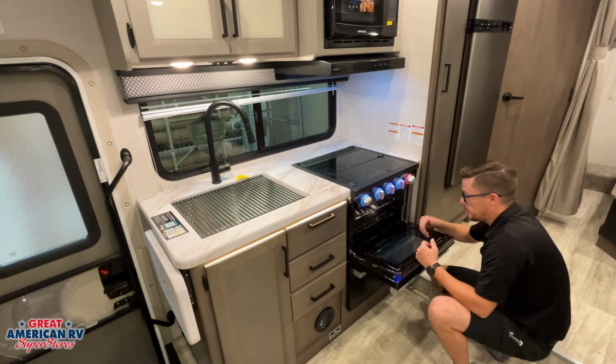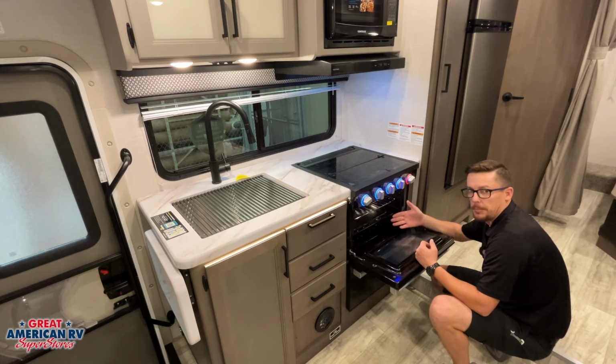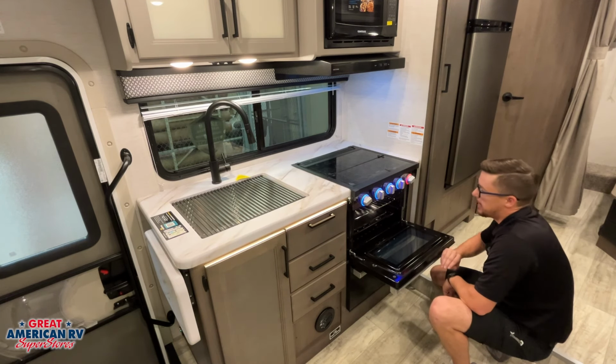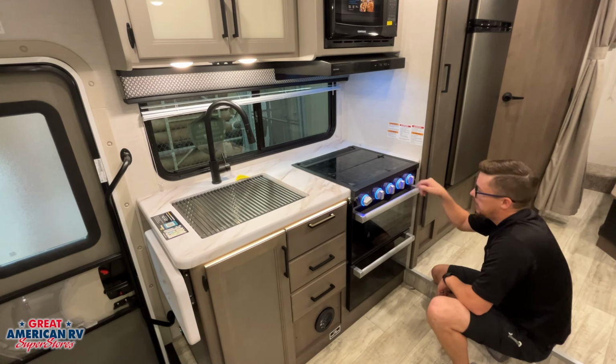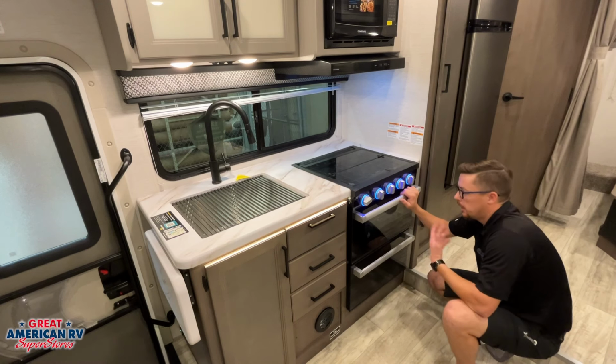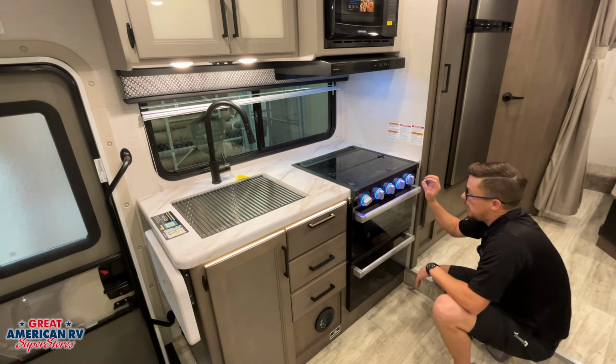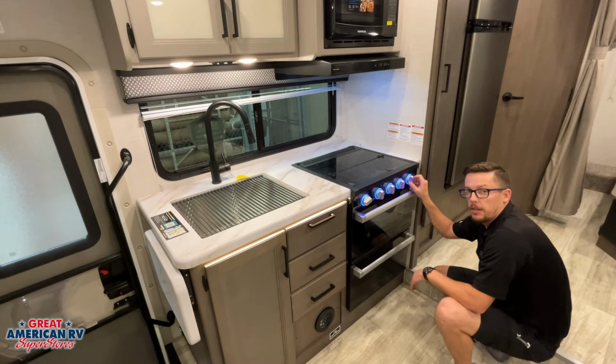Now, that burner tube should light up. It still may take a little bit of time after the first time you light it, after you bled the air out. That's only because that hole is very small and it takes a little time to bleed the air out. But it will light eventually. If that flame goes out, just go back, relight it, hold it down for another 15 seconds, and then go to the appropriate temperature again.